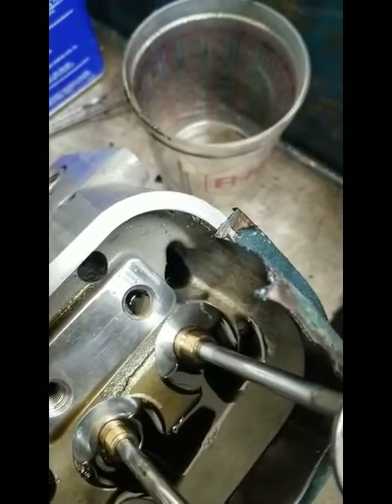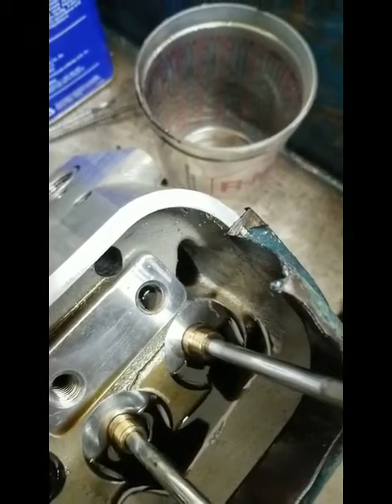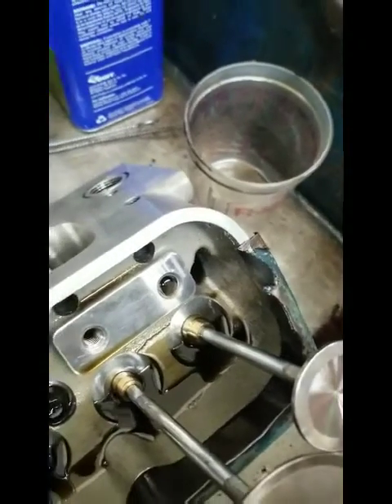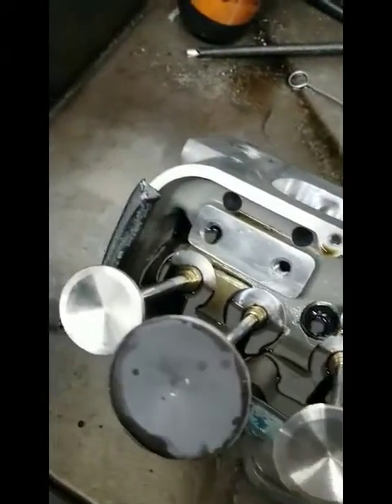We radius the oil passage back to the return so that oil can get back there easier. I just thought I'd show everybody that — a lot of people are concerned about it, but it's more than adequate for most engines.